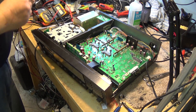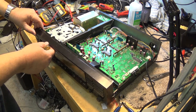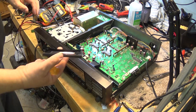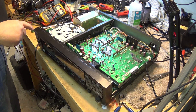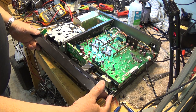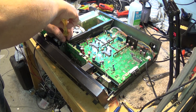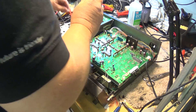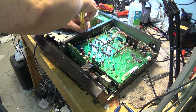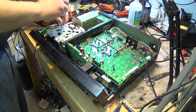What we need to do is remove those four screws. We have to remove the front cover first — take the tape compartment out, take the front cover off — so that you can remove the four screws across the front and remove the front of the machine. Then we're going to remove a screw down here, another screw down here, and there are two more on the back side.